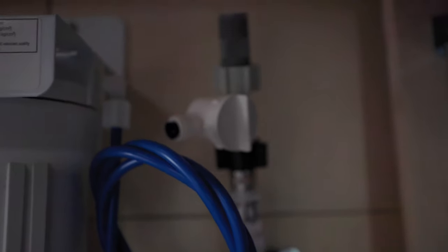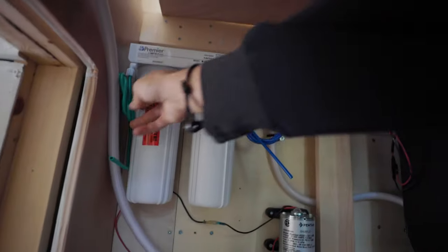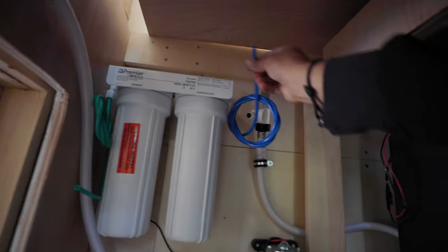Up there there's a splitter and that is for this big water filter. This green one here is going to hook into this little end and this is what's actually going to go up to the faucet. The next challenge is making sure it all works and that I don't have any leaks. My plan is to carry three six-gallon fresh water tanks — maybe two under here and one in the garage — for a total of 18 gallons of fresh water and then one six-gallon gray water tank. As one fresh water tank empties, I'll know I need to empty the gray water tank to keep things on track.